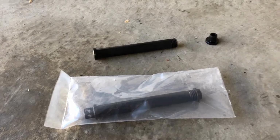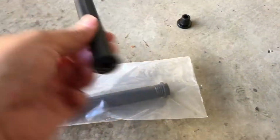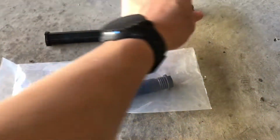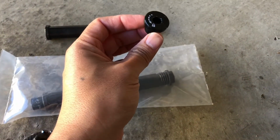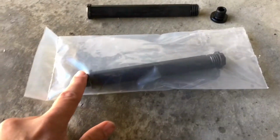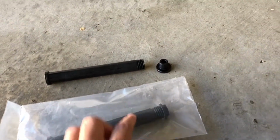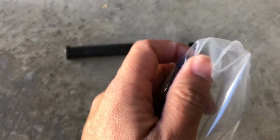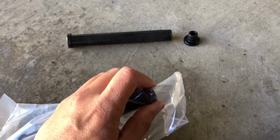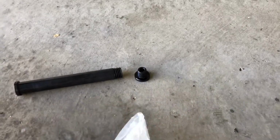So on the Reese Racing website, the axle looks a lot like the original one that has the reverse threaded locking cap. But what I noticed when I ordered this new one, it has these, I believe it's 17 millimeter, and just fiddling inside the bag, the locking cap is threaded normally, so it's going to be righty-tighty, lefty-loosey, unlike the one that it comes with.